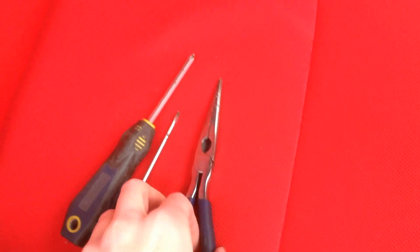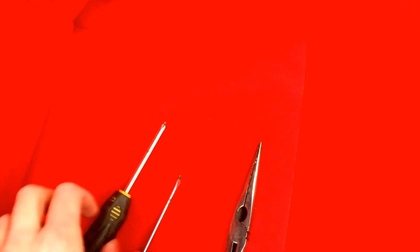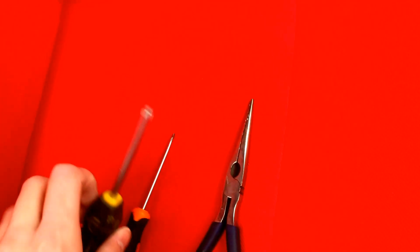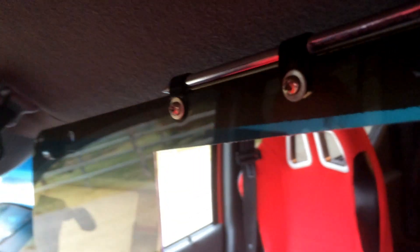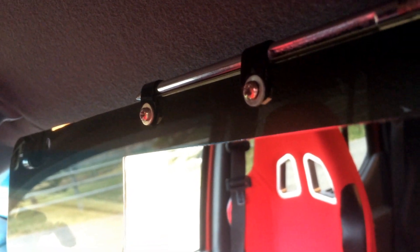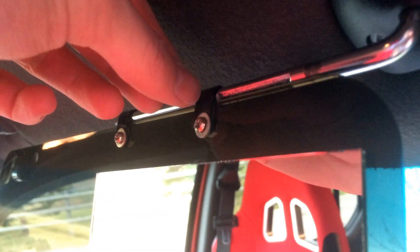To get them back in, you're going to need needle nose pliers, a Phillips, and a little flathead. I'm just using a little flathead because it's easier to get it super tight. This one kind of grinds away at the head and ruins it, so it's even harder to tighten. As you can see, both of them are in. You're going to need to use the needle nose pliers to keep the nut in place. When it comes down, the mirror is on it and everything. At the front, don't forget to put a washer on it because the P-clip can bend slightly, especially if it's warmer out, and then the nut head will go right through the plastic and it won't work. So don't forget to put a little tiny washer on it. Then the P-clip slides right onto this thing.